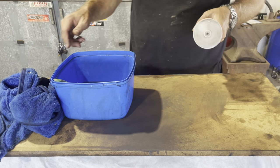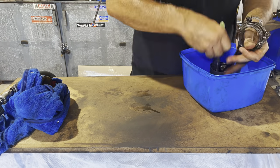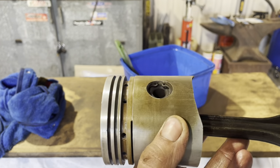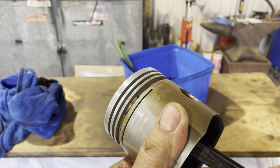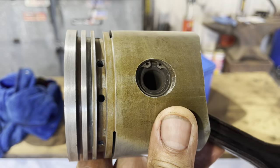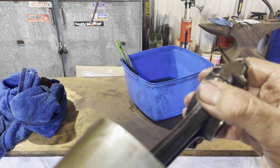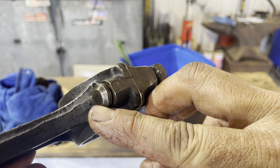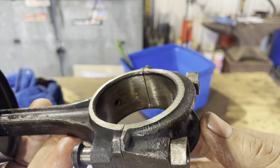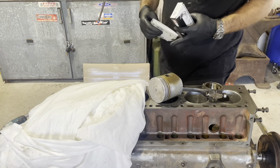Let's clean these pistons up with a bit of petrol. The grit sandpaper was 400 wet and dry - it just cleaned them up, didn't take any surface off. A couple of the rings were really seized in, took a fair bit, and there's a lot of carbon in there. One thing to keep an eye on - there's a little pinhole right there. If you turn it around you can see that little hole in the back - that's what sprays oil onto the cam where your lifters go, just to keep it lubricated.